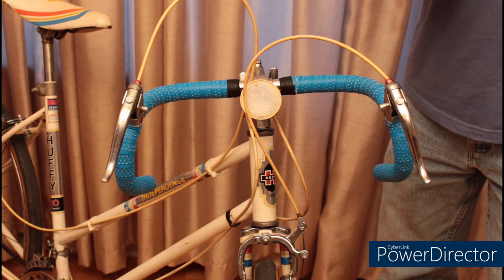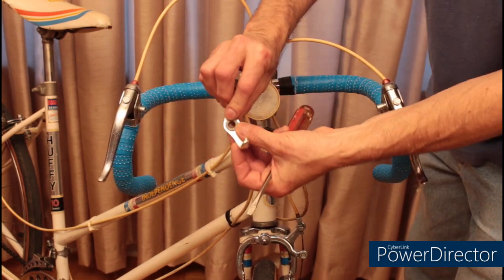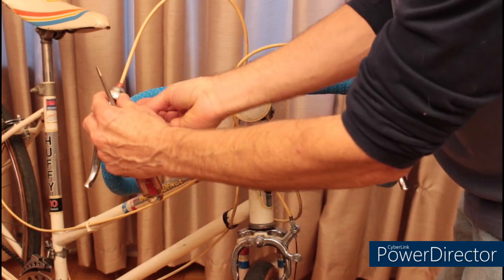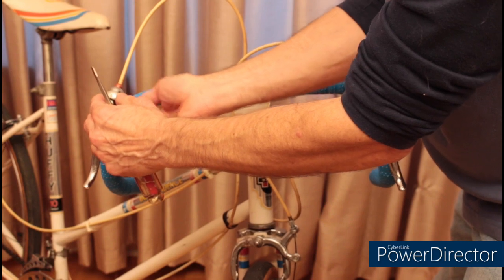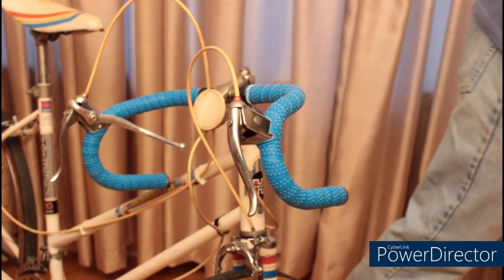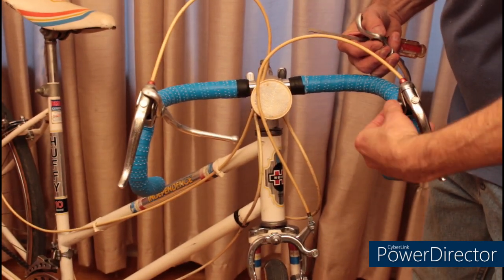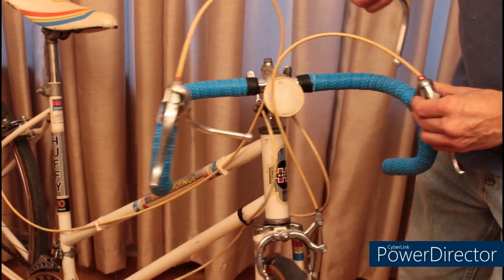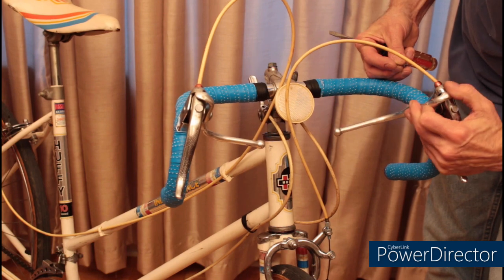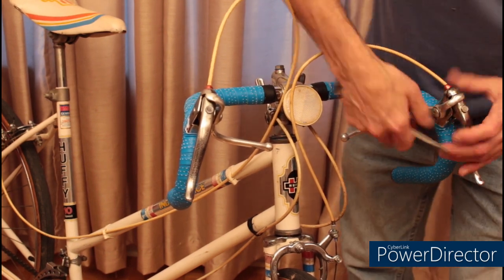At this point, I'm going to reinstall the safety levers on my brake handles. I'm first putting down the washer. I've reinstalled the plastic grommet on the back of the safety lever. Slide it into place. I've got the lock washer on my screw and we're going to tighten it down. On the other side, we're going to do exactly the same thing — install the washer, the grommet is inside the safety lever already, put the lock washer on the screw and tighten it down.